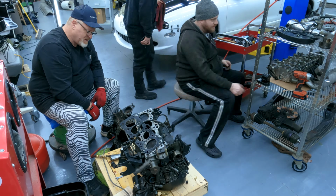So under the passenger side carpet, the foot well, there's this cover here. If you take it off, you'll find the ABS computer and relays, and this is a ground. Since we pulled the ABS pump and we're not having anti-lock brakes, I don't need any of this. So I'm gonna remove all that, and that's actually gonna give me some space to pull the main engine harness, which is right there, back in and kind of maybe coil it up in here to pull back and hide it better. So yeah, I'm gonna take this stuff all out.